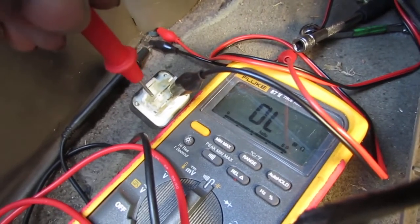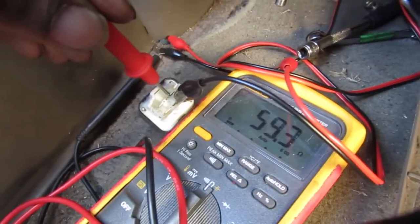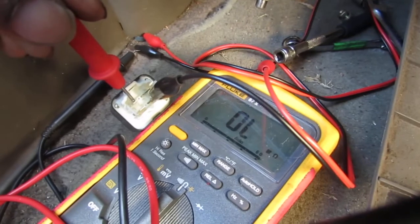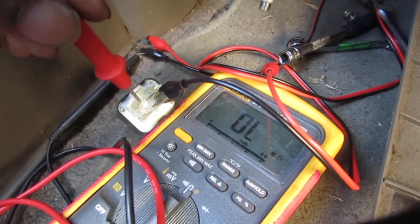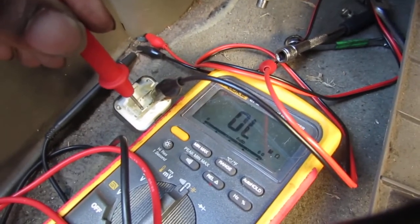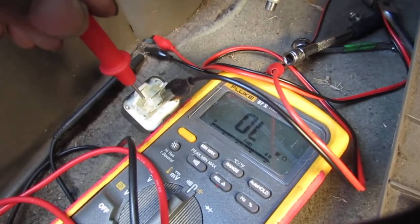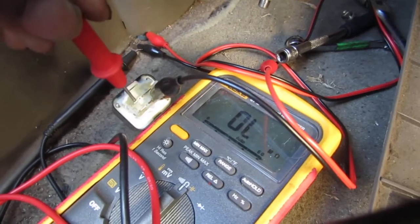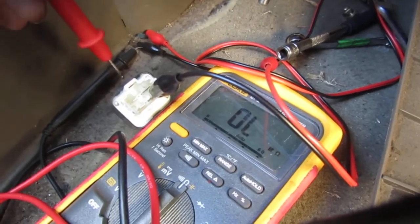So what that tells me is, I don't really know, this could be high for resistance, I'm unsure. But I do know that we need to energize one of these two legs. I'm sorry, maybe energize this leg and that leg. We have to figure it out. And just see if we hear any clicking sounds. If it clicks, these two right here where the red is touching will close. And if those two never close, then we know for sure that this is our point of failure.